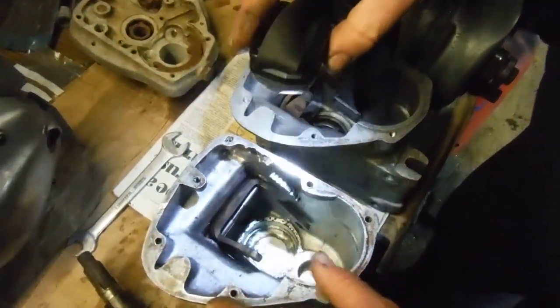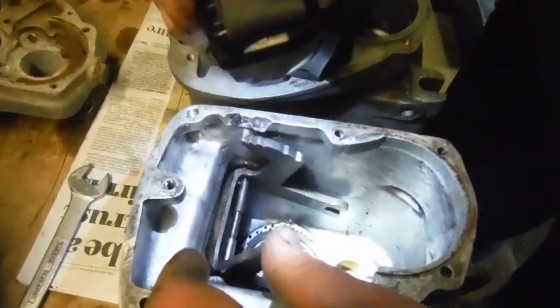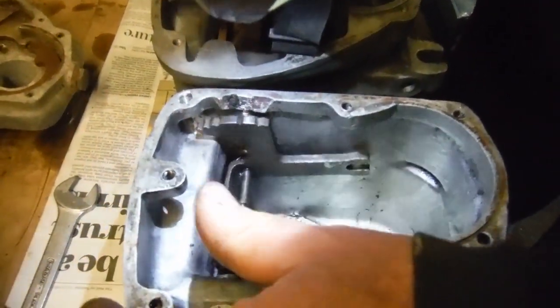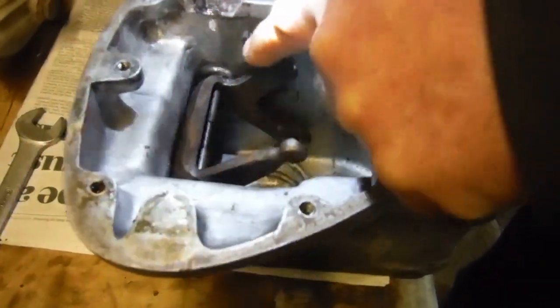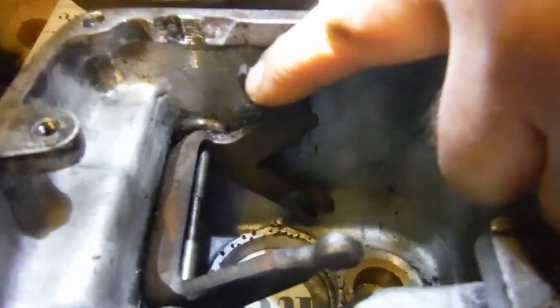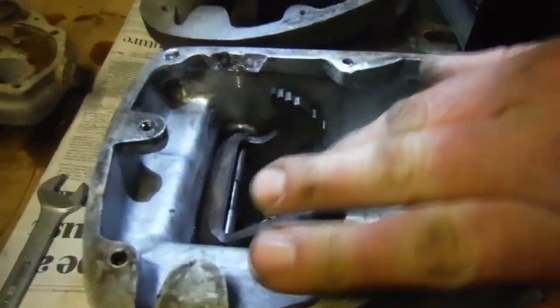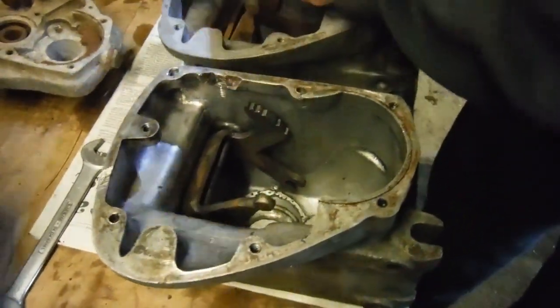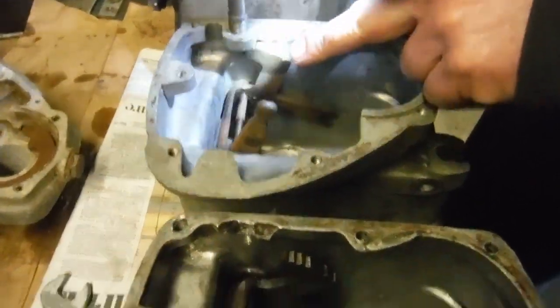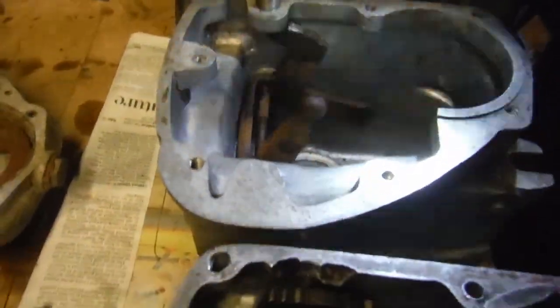This is obviously an empty gearbox shell, and you can see this here that moves like that. This is actually called the gear operator, which is part of the selector mechanism, and those notches there represent first, neutral, second, third and fourth gears. And this casing is actually broken. What you would actually have is this piece here, and there's the spring-loaded plunger that engages with the gear operator,